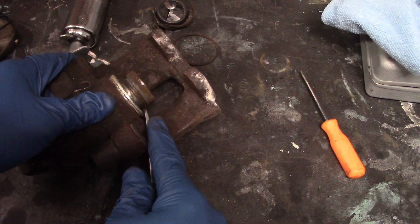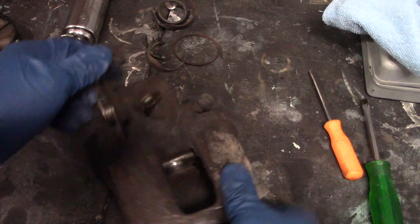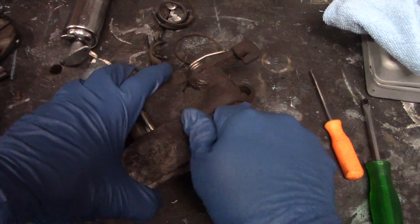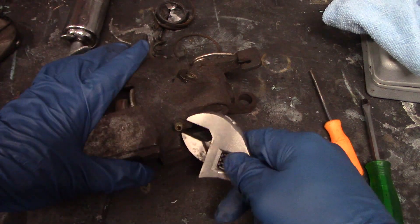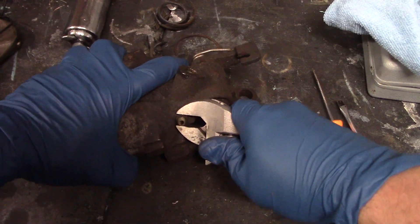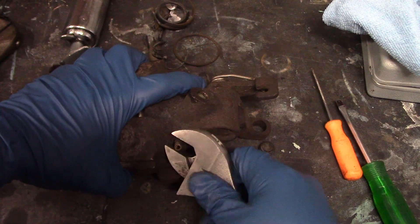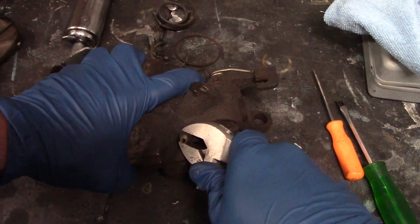The piston is not going to come out easily, so we're going to have to push it out. First, let's see if the lead screw will come loose. We'll back it out most of the way if it'll come loose, and then screw it back in — you don't really need to take the whole thing out unless you just want to clean the bore.